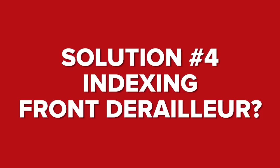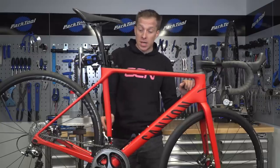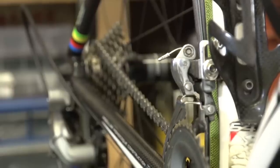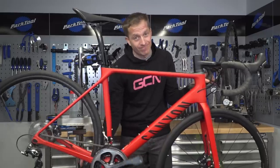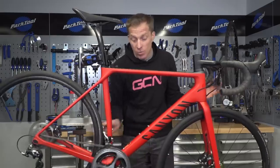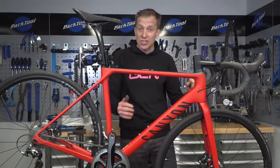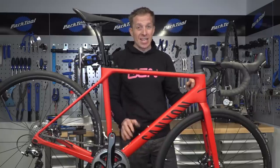The most common response to your question, Mark, was that the front derailleur itself needs some looking at. My advice: unclamp the cable and start afresh — reclamp it and then adjust the screws. We've got a link in the description below for a video on how to adjust your front derailleur, or just up here, and hopefully that'll be your problem solved. However, I still don't advise trying to change from one chain ring to another while sprinting. The load you're putting through it and the change in cadence — if your chain were to derail, the consequences aren't necessarily gonna be in your favour.